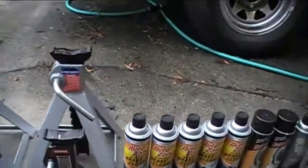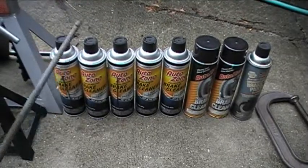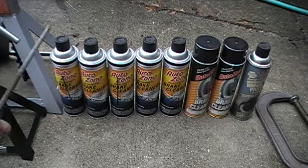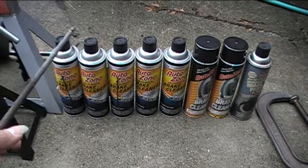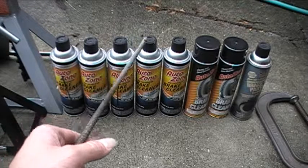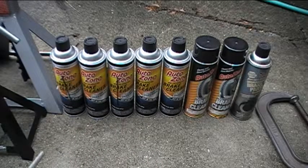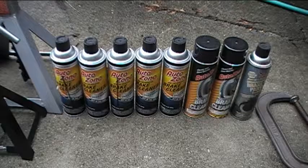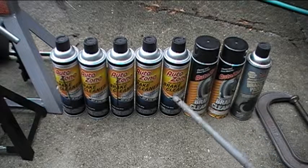The next thing I have is brake cleaner. So once I get the wheels off, I want to clean the brakes first. I thought about eight cans — yeah, eight cans of brake cleaner here. I figured about two cans per wheel should probably be enough to get them all cleaned up. Now, you want to use this and you don't want to use compressed air because a lot of brake pad material is made of asbestos. Asbestos is very bad to breathe — it's carcinogenic and can cause cancer. So you don't want to be breathing in that dust. If you use a spray like this, it'll help to clean off and capture that dust, and it'll just fall into a drain pan where you can collect it.